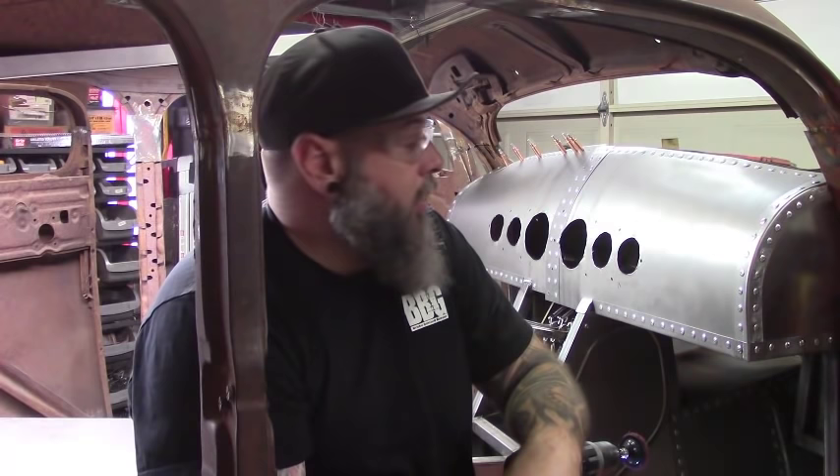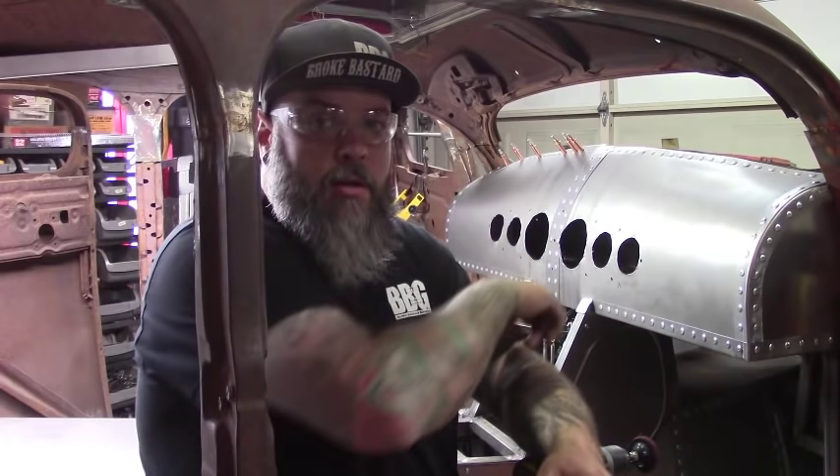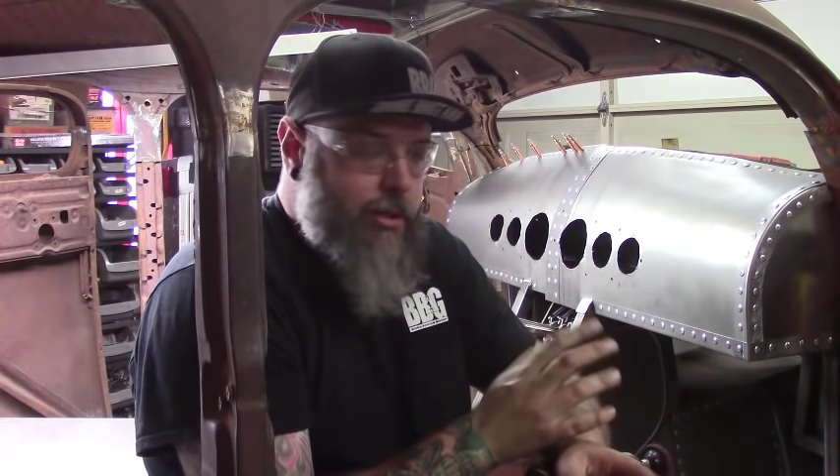They're not pretty by any means — I cut them by hand. Everyone's going to say 'just use a bigger hole saw,' but I don't have the right size. It would need about a quarter inch over the normal hole, and the ones I do have are too big — the hole would be bigger than the plate going on. I cut them by hand; you're not really going to see them, just need the clearance. You might ask why I didn't cut the whole design out of the dash — I'm trying to leave as much strength in the dash as I can. This might go different and I may have to cut more, but let's see what happens.